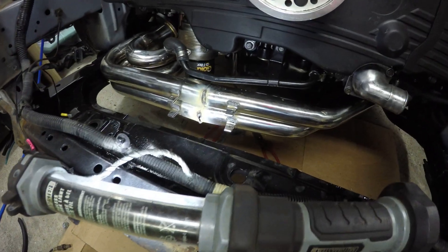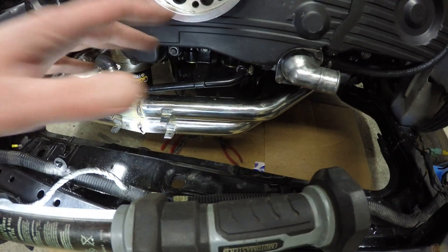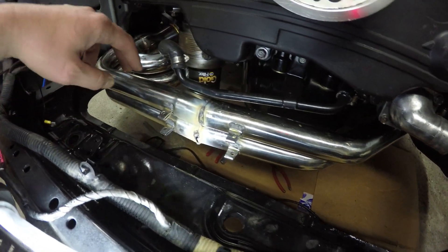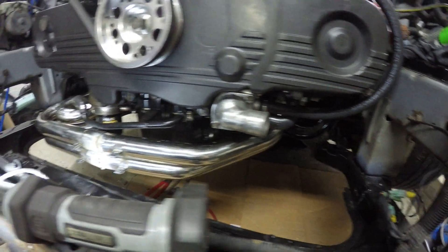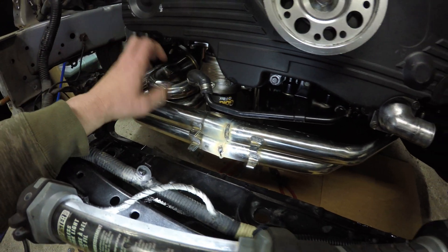I'm moving along at a pretty good pace — I've already had the pipes cut, took a quick pic of it, and been able to sit them in place exactly where I want them. I've got tacks up on the flange part, which is kind of hard to see up in there, and the pipes are sitting into the secondary pipe with a good bead and a tack. I'm ready to take it all down, finish welding, put it back in place to check fit, clean up the welds, cut off these tangs, and get ready to paint.